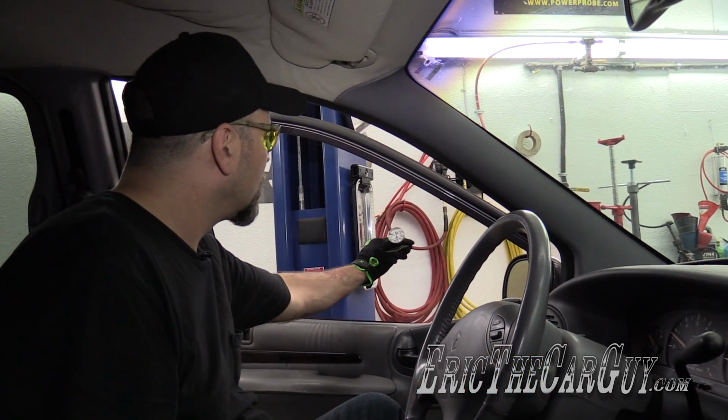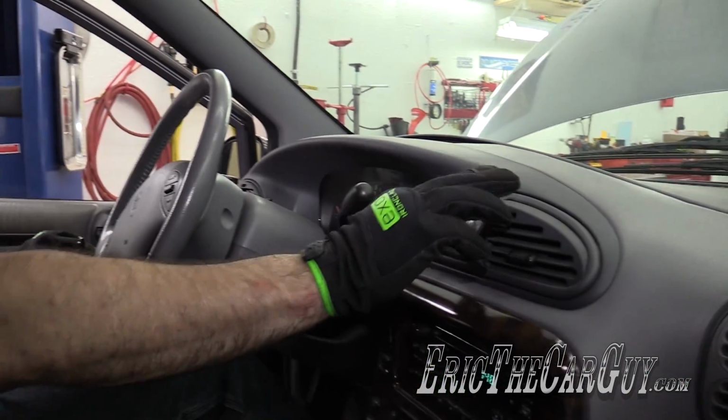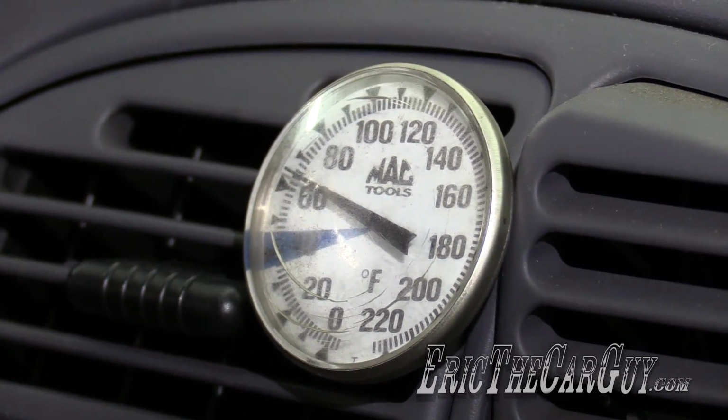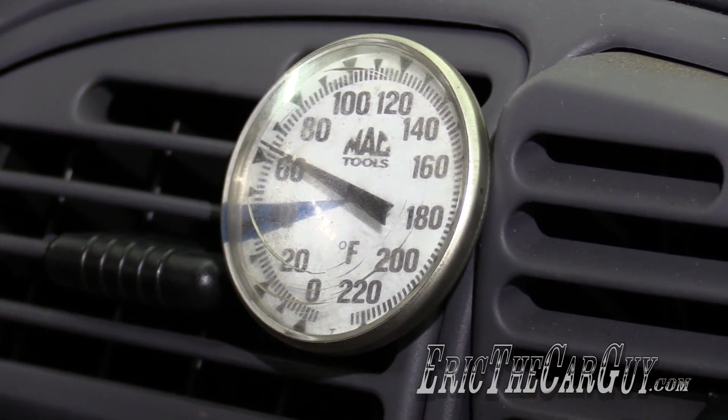It's colder. Shop temp right now is about 81 degrees. All right, we got it to come down to about 60 degrees, but the longer it runs, the warmer it gets. And it's coming back to that high side pressure. Every time the cooling fans kick on, that high side pressure comes way down. Whereas when the fans are not on, the high side pressure stays up in a nice place, and I think that it actually functions more efficiently.